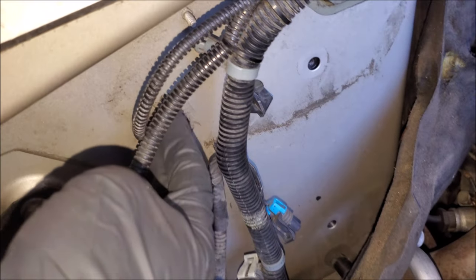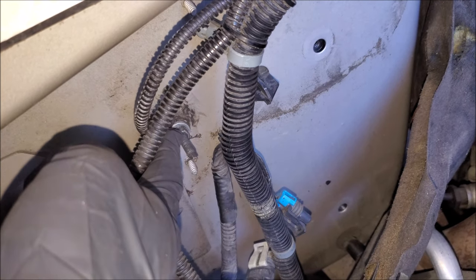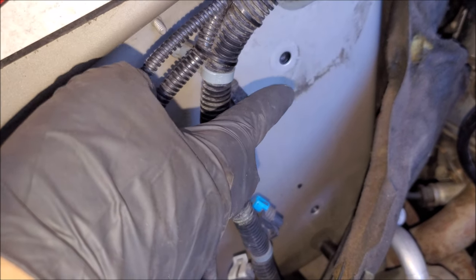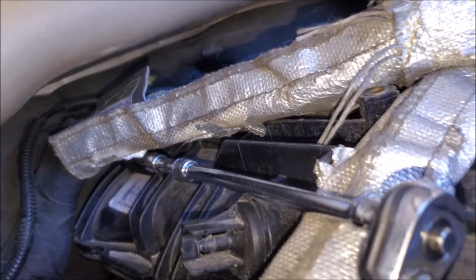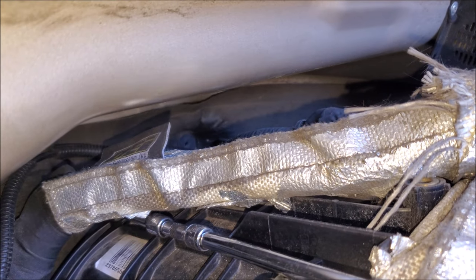For reinstallation, I find it easier when you've placed it inside with the guides lining it up to put the nuts onto the studs first. That way it brings the box all the way to the firewall, then you put in your 10-millimeter bolts. I also find that using really long extensions really helps — that way you can get on there and you're not struggling to get a tool deep down into the cowl.